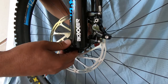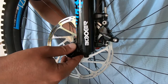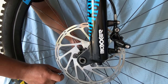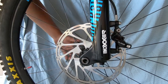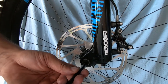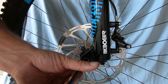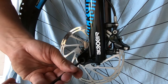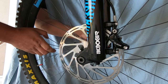It's really important that you properly break in your new pads. That means don't take it straight to the nearest downhill park. What you want to do is do a couple dozen low-speed slowdowns — you don't actually want to stop. You just want to transfer material from your pad onto your rotor, and that'll help them work well together.